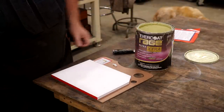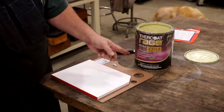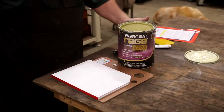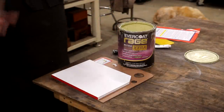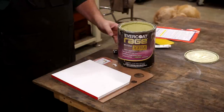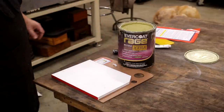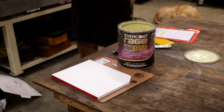The product we're going to be using for body filler is Evercoat Rage Ultra Extra. This was recommended to me by some of my viewers who do more of this type of work. In the past, I've just always used the standard Bondo that you can get pretty much anywhere. I will say that I really like this product compared to standard Bondo. It just seems like it lays down easier, sands easier — it's just a better product all the way around, in my opinion.